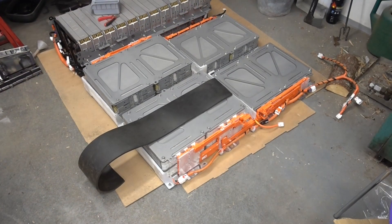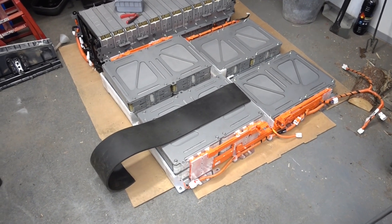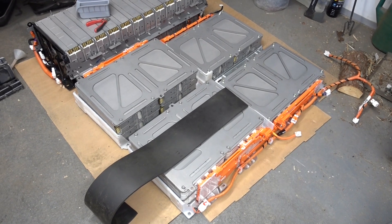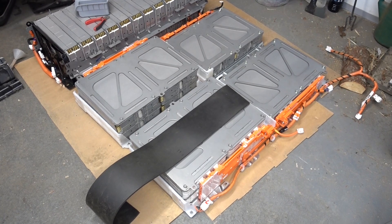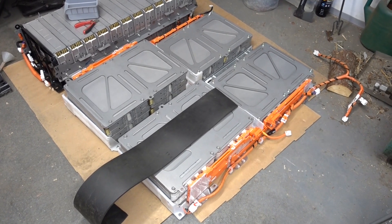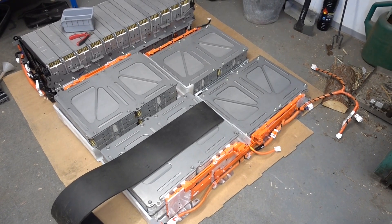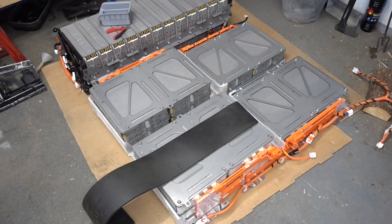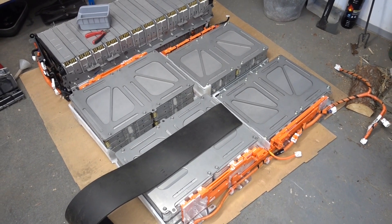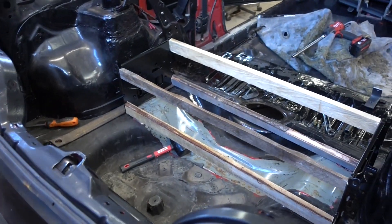New game plan: after getting the wiring back together — which took an hour to reconnect — I've concluded I'll just flip the stacks as they are on top of each other. I'll use this thick, heavy-duty rubber sheet in between the two stacks — no worries about it melting if the cells reach 50 degrees. We'll build some metal pieces to join them together and keep everything sturdy. It's a shame we couldn't stack them directly, as that would have saved weight by deleting two compression plates, but it is what it is.